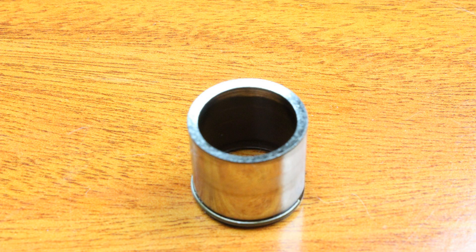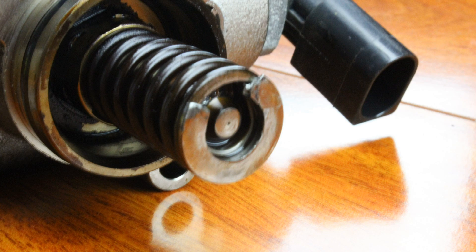The more important and fun thing is how it fails. I've seen every kind of failure with these parts — followers worn completely through like this one, just a little bit worn, cracked — you name it. I've actually seen the metal pieces get into the timing cover and cause damage to not just one but both camshafts, the adjuster on the exhaust cam, as well as the oil control rings inside the housing. Typically the weak point is the follower. Weak metallurgy in the follower, especially the original ones, would begin to wear the lobe on the camshaft. As that happens, it creates more wear on the follower, eventually wearing all the way through and damaging the fuel pump. Catastrophic failure can occur with pieces of metal from the follower getting inside the timing cover housing.